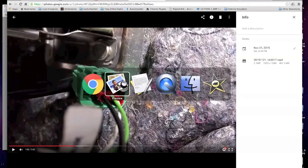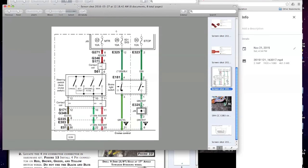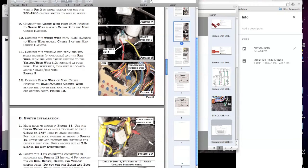And let's go to the power, right? So MTR, and then you saw in this wiring diagram, 22. Okay, here's our power block, and I really don't totally understand, but you see 22s here. I know these two are accessory ones, and I believe, I'm not 100% sure, but I believe this was the blue and yellow wire that Rostra mentions. If you look at Rostra's instructions, they're like, hey, you just clip this blue and yellow wire. And if you know me, you're kind of like, what? I don't know where the heck that is.